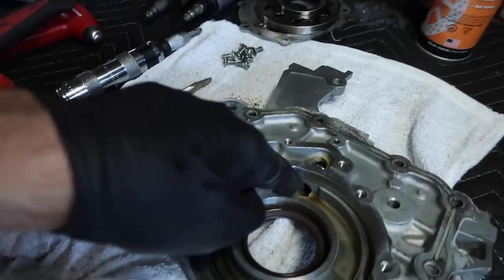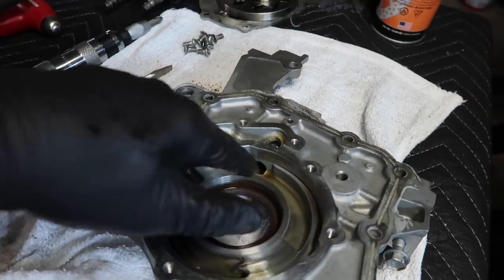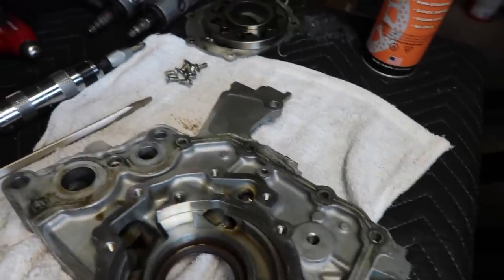If you have CP pistons, follow what they're asking; if you have Carrillo rods, follow what they're asking. Then you might want to think twice about how much you port this, because you'll go overboard. If you're using an NA block without oil squirters and it doesn't need to send oil through all that, it's going to have more oil pressure. So all these things you need to factor in, including how thick of oil you're going to use — the 2JZ originally wasn't supposed to use 20W50 or 10W60; it's asking for 10W30 or 10W40.